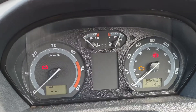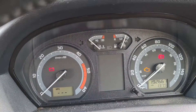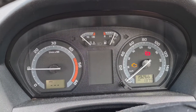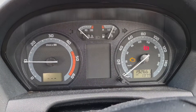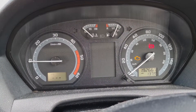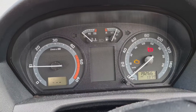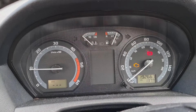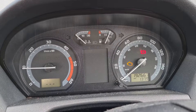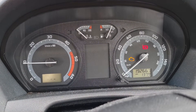Also, whether it's related to this fault I'm not sure, but the engine management light stayed on when I started the car. And it revs really weird when it's cold. My theory is it's been putting the glow plugs on, because the coolant temperature sensor is open, it's reading as low as the ECU will read. So it thinks we're in Arctic conditions, putting the glow plugs on for ages. When I start the car it's revving higher because of that, and then I get a huge plume of black smoke out the back. That's my theory anyway.